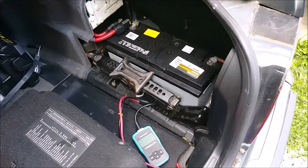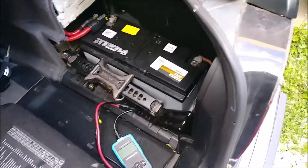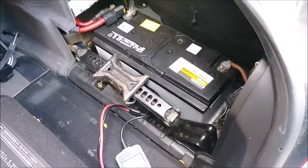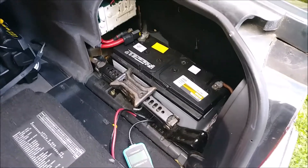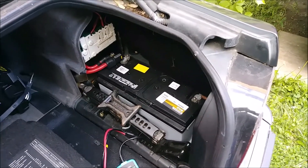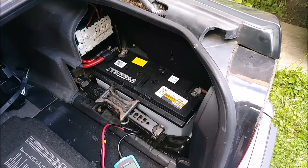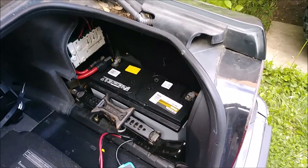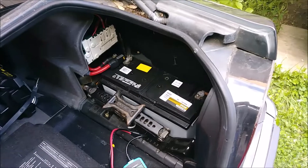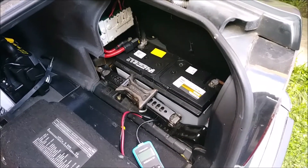You can charge from a low state — it went down to like 11.4 volts and came back up a few volts. In my opinion, the best application is maintaining the battery: if you've driven the car and it's been charged by the alternator, then hook up the solar panel if you're not going to drive it for a week or something. But you could theoretically charge a battery with it. That's the Harbor Freight 7-watt solar charger — my review and testing of it — and surprisingly, it works. Thanks for watching, peace.